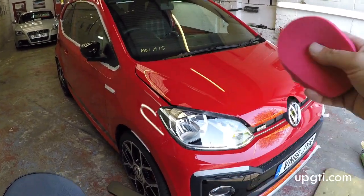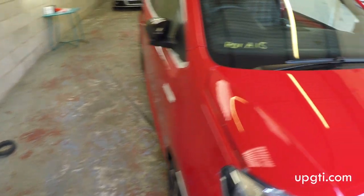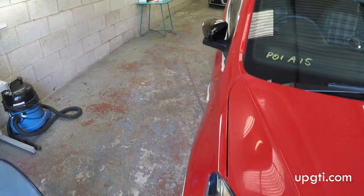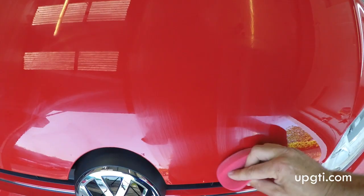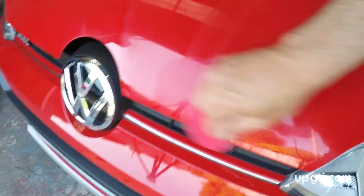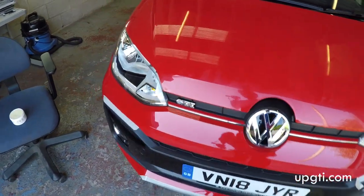Rather than show you the process of waxing the whole car, I'll just show you the bonnet. So this is the applicator — it's still a bit damp. This is the tub of wax. And then you just apply it like so — you want to spread that evenly. It goes on really well when the panel is nice and clean — that's the benefit of doing the preparation. It really does not need to be particularly thick. Make sure you do all the edges, and then leave for 15 minutes.